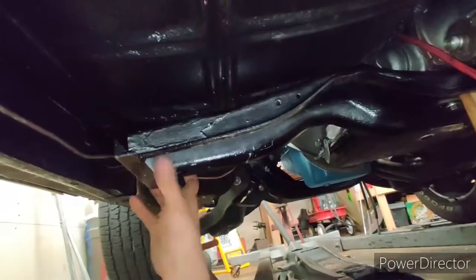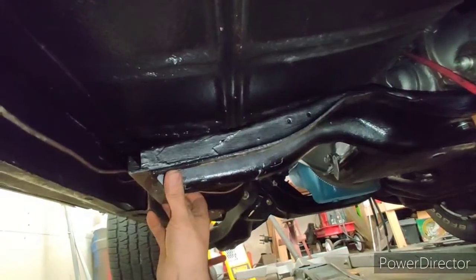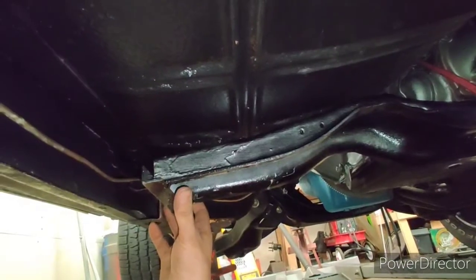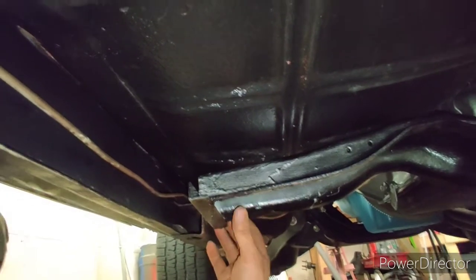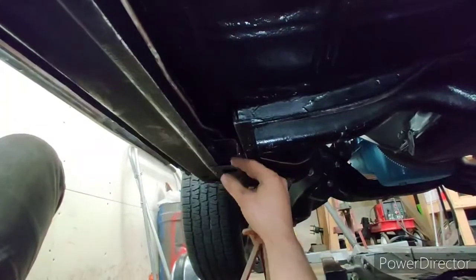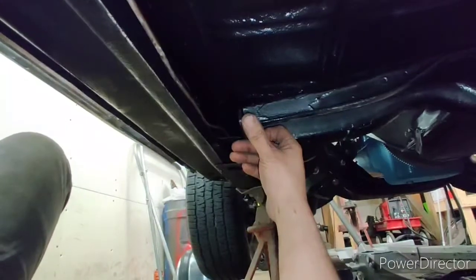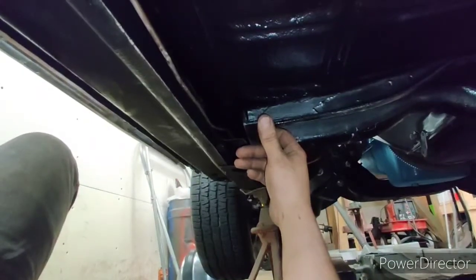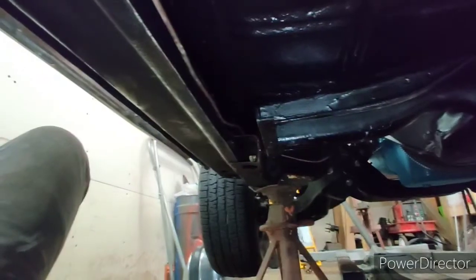In the morning I'm going to pick up my grinders and cutoff wheels from work, then take a trip to Farm and Fleet to pick up some angle iron. I need to find about 120-wall stock because the MIG welder has a limited duty cycle — the thicker the material, the longer it needs between welds. I'll pick up the angle iron tomorrow, weld it all out, and bolt this thing in.